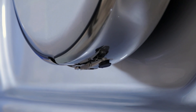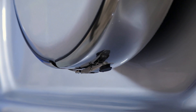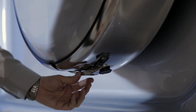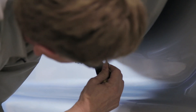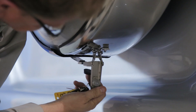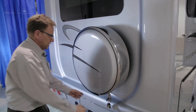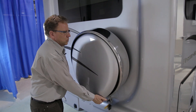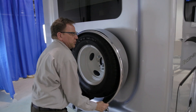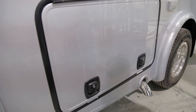The rear of your coach features your spare tire mounted on the rear, enclosed in a continental tire cover. To remove the continental tire cover, you will need your 602 key. Slide the key into the lock, turn it 90 degrees to release the lock, unhook the lock, release the retaining clip, release the ring, remove the cover, then open the ring and slide it off your spare tire.